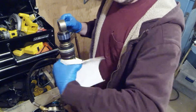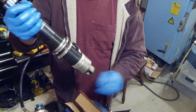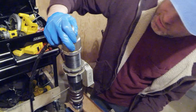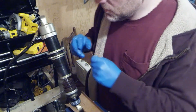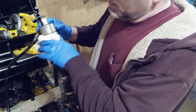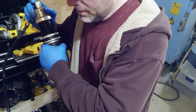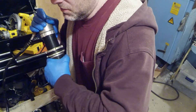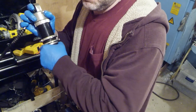But on this shock, because it's a unit with the plush ride system in it, I can actually turn it up and let that air come up to the bleed hole in the top. I used the little hole — it's a 3/32nd screw — and it is very convenient to have. I just got the last of my air bubbles out of the shock. Now if I move it up and down, you don't hear anything but fluid moving — no gurgling noise. I'll leave it overnight and bleed it one more time, but that's the basics of it.